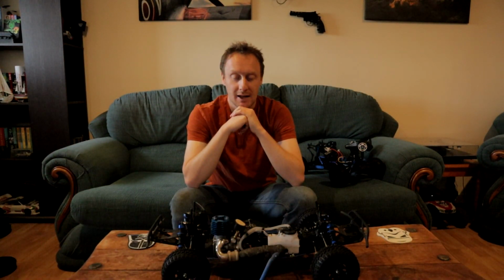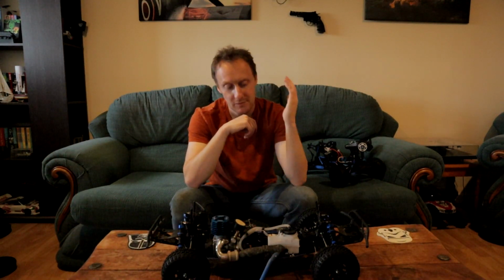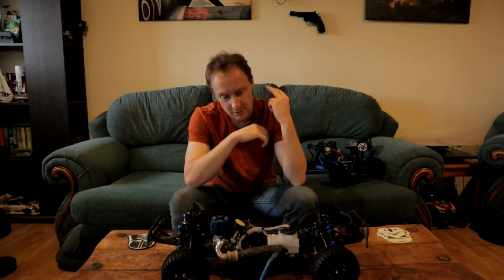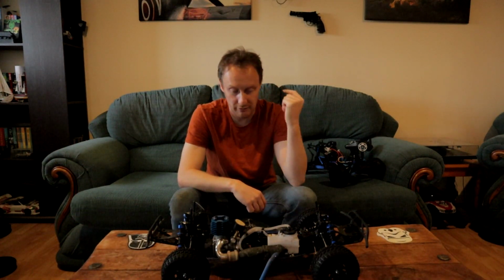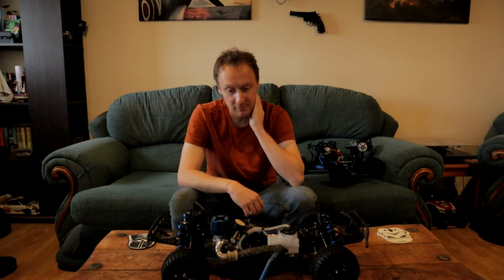I finally finished running in the FTX Zorro Nitro. Two tanks at idle, two tanks at quarter, two tanks at half, two tanks at three-quarters, and then one at full chat. Not flat out all the time, but full chat, and it's pretty good.